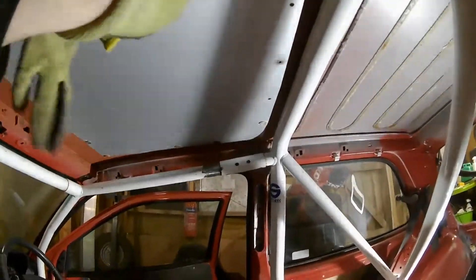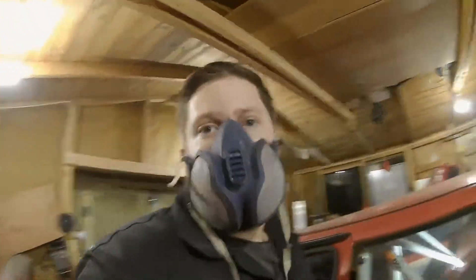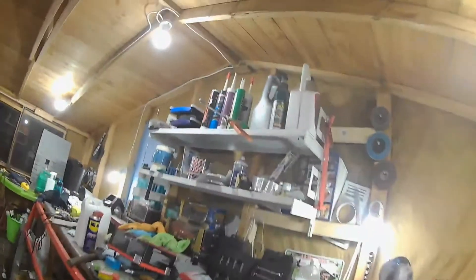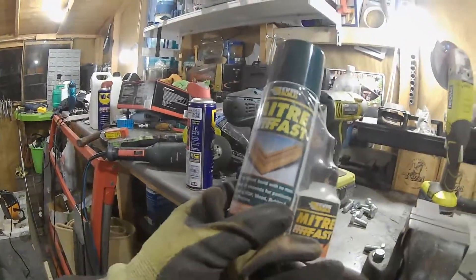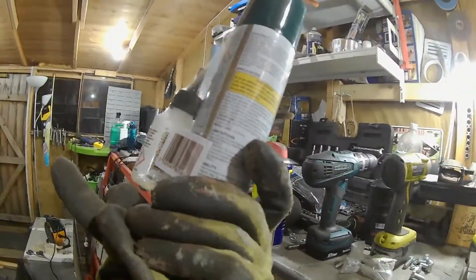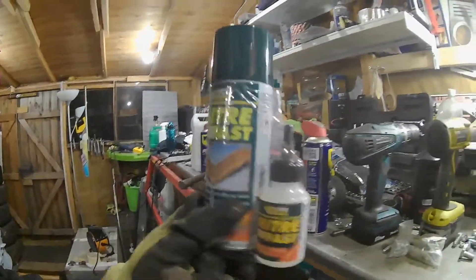The only other thing we need to do is sort this roof bit out here — you can see it's not fixed to the roof anymore. I've got some really strong grab adhesive, a two-pack epoxy — it's Mitre fast — and I'm going to use some of this. It just bonds stuff like crazy together, works on metals, really quick grabbing stuff. That's what I need just to secure that sunroof panel back up inside the car.